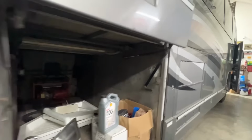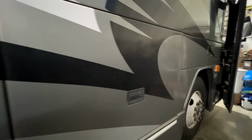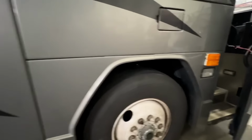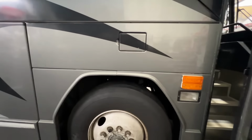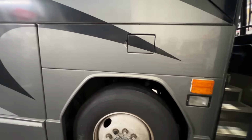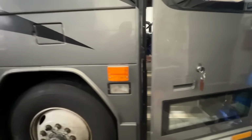Up front, we're getting the two new air tanks. We'll have those first part of the week because both those air tanks were all rusted out. The Norgren valve has been replaced, so that leak's taken care of. So the only big leaks left are those two in the air tanks, and those two fittings back there on the brake chambers that leak when you apply the brakes.